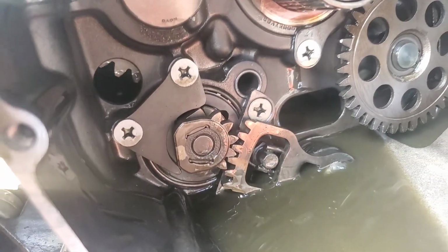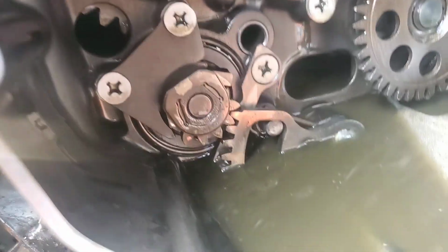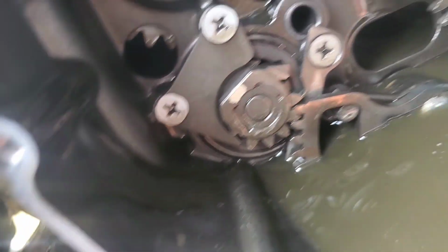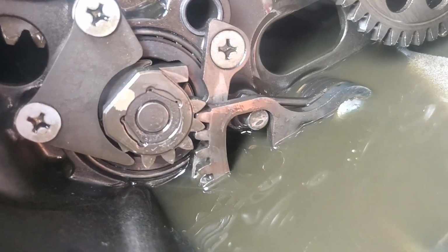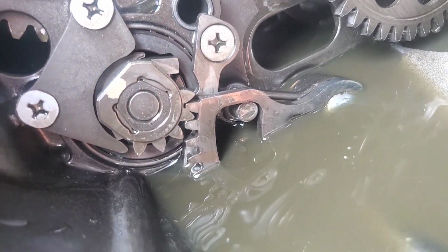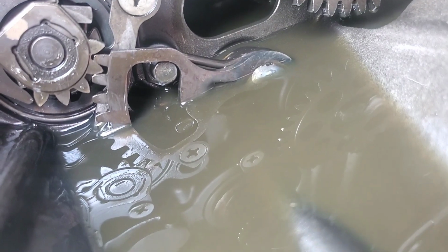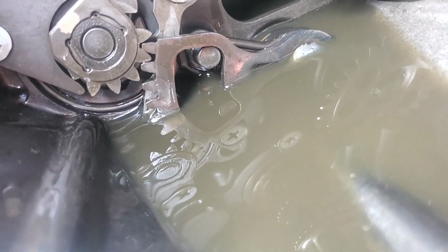So I got to come up with that shaft a little bit, so that I have just that much more room for it. That little puck right there, there's that one, and there's one on the other side. See it in there? They're engaging on the shift drum assembly right in there on that edge and pulling it. They're trying to pull it, but it just runs out of room. See where it's catching on that pin right there? So that's doing what it's supposed to be doing. It's binding it, keeping it from going too far.